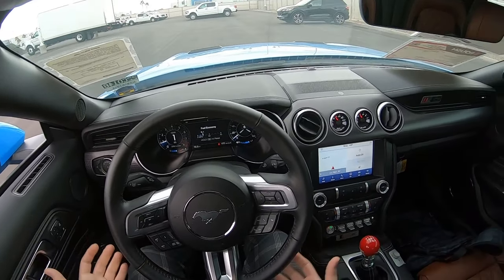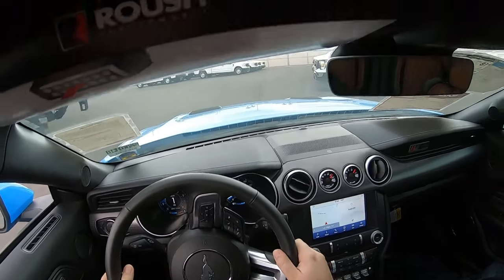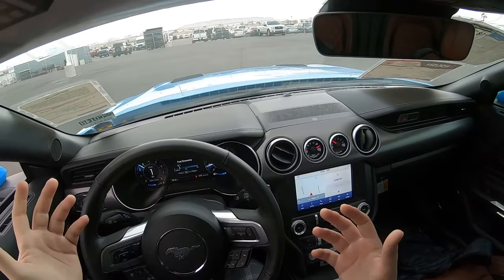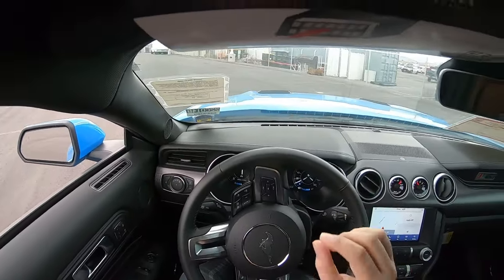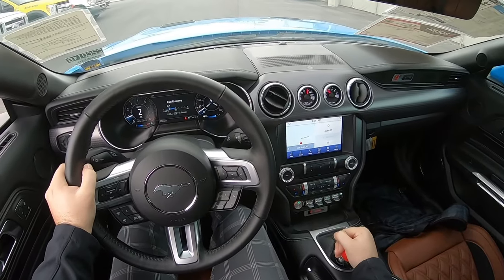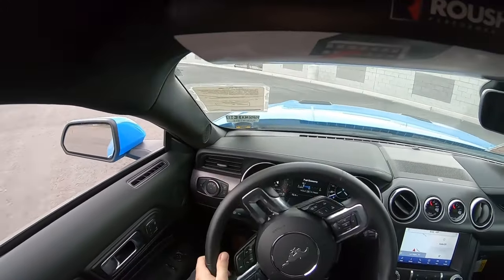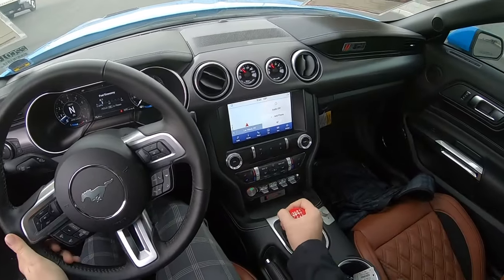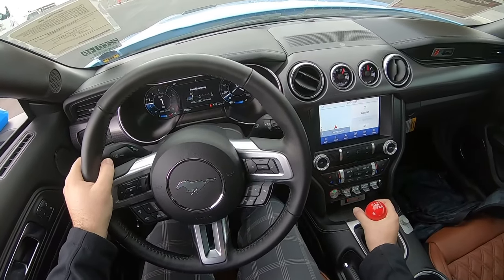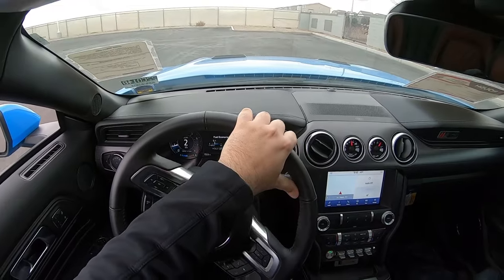As you can see it's starting to take off and we're moving. Now we're actually moving in the Mustang. Of course you're in first gear — it's not going to shift because you have to do it yourself, that's why it's a manual. So to shift: while you're driving, push the clutch in, go to second gear, let go, and you're moving. Let me show you one more time from a standstill — foot on the clutch, in first gear, you start letting go and we're taking off. Then clutch in, pull all the way back, clutch out — that's second gear, as you can see up there. And that's how you do it for the rest of them.